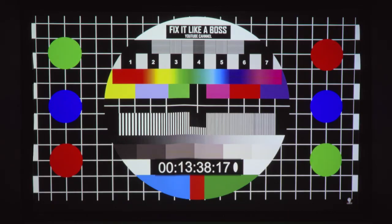So one other thing we notice is something called chromatic aberration, which I'm not sure if you'll be able to see it. We had to get really up close to the screen to notice it, but it's faint, but it's there. If you look between where the black square and the white lines transition, at the bottom of the square, you can see it's very faintly green. And then at the top of the square, you'll see it's very, very faintly magenta.